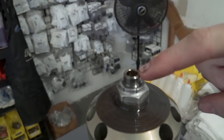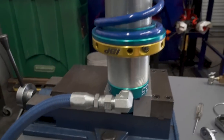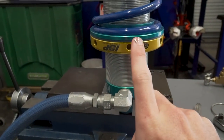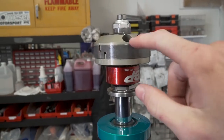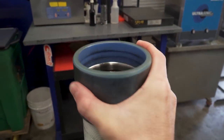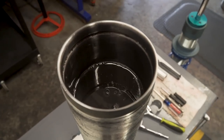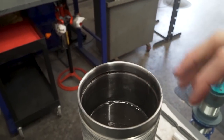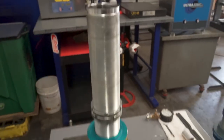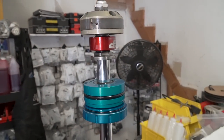There is a hole in the shaft right here - this is part of the internal bypass. There's a hole in the shaft that a pin inside of the shock body comes off the top cap and sticks up, and that pin actually goes into the shaft into this hole. That is what gives you your bump zone. Now since we have the valve body out, I can get the spring divider off with the upper spring, and then go ahead and dump the oil into a container to see how dirty it is. It's still really clear - the shocks don't have very many miles on them. We'll get that dumped so I can start pulling this hose apart and spec everything out.